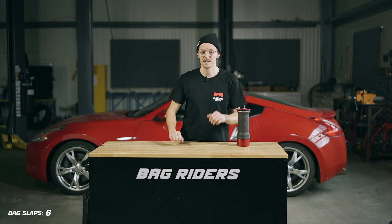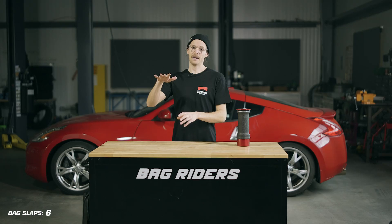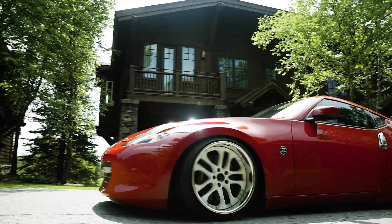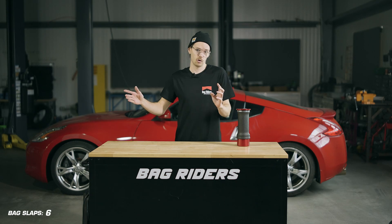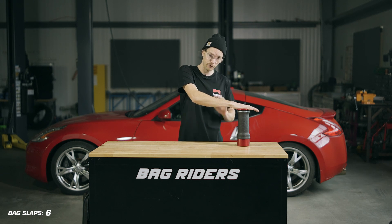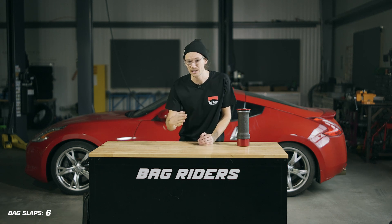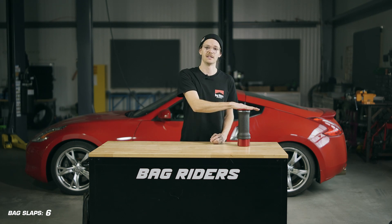The reason for this hate actually comes down to presets — more specifically, pressure-based presets. Here's a scenario: you're driving along at ride height and you want to add a bit more air to your bags, maybe just the front, because you're going into a steep incline like a driveway or a gas station, or there's debris in the road. That's why you bought a digital controller with presets. Well, in the case of front rolling sleeve bags on your front struts, those presets might not actually get you to the height you think they will. Yes, they will achieve the desired pressure, but will that result in the desired clearance to avoid damaging your vehicle?